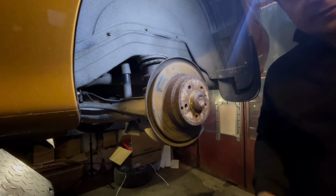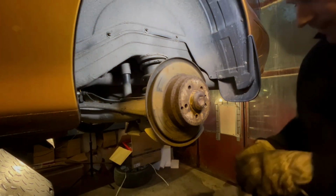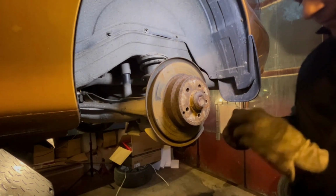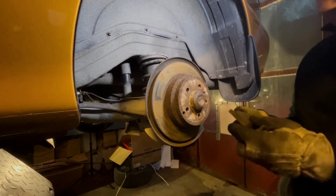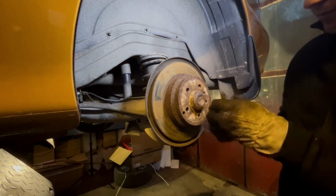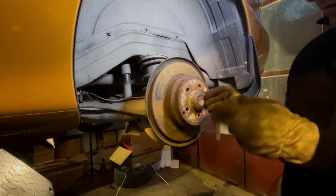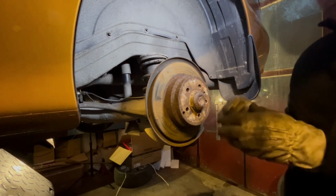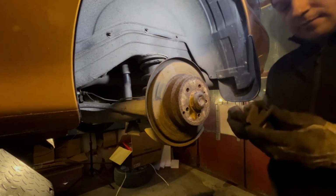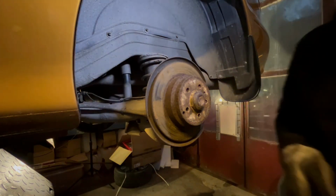I was replacing the other side on the rear, and didn't want to film it, but you could actually see that the pads had been sticking, because these ones are much thicker on both sides, so this caliper hasn't been sticking. But anyhow, we have new brake pads, so we can replace them. The other one was like twice as worn as this one. Good.